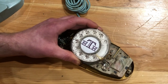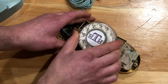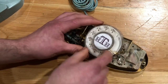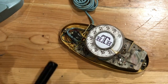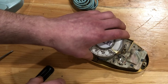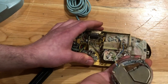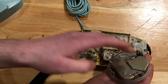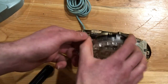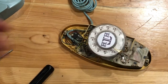It's all working! I'll try and dial out later on but I'm almost 100% sure it'll still work because I've usually never had an issue with the contacts on the rotary dials. But if they do need to be cleaned I would carefully remove this plate and that should expose the contacts underneath. I won't try that right now unless I need to later, which I'll make a video on. Anyway, thank you for watching - I hope you enjoyed this video. If you have any questions or comments just let me know.